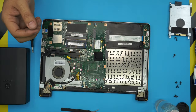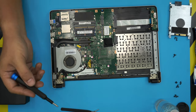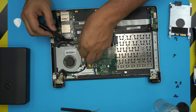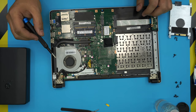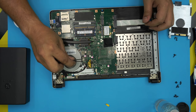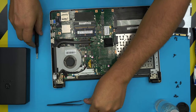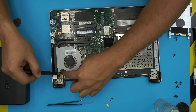This is the bottom case — go ahead and clean it up. Down here we're going to see the fan and the heat sink. There's no GPU in this version, but your version may have one, in which case the heat pipe will extend further and you'll have more screws to remove. The warranty label is right here — peel it off carefully so you can safeguard it to one side and place it back on later. We're going to remove the fan cable using the curved tweezers — put the tweezers right at the edge of the fan cable and push it towards the left side.